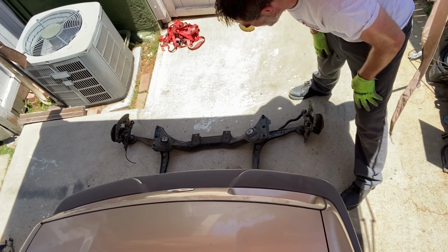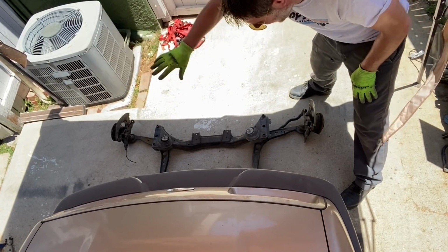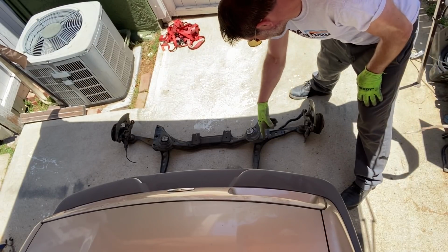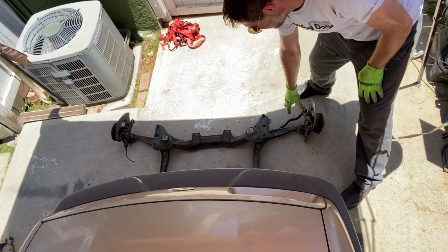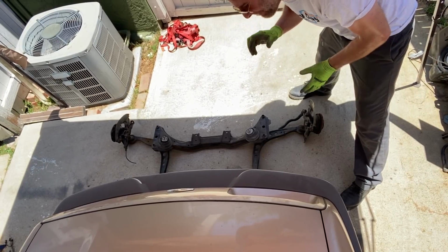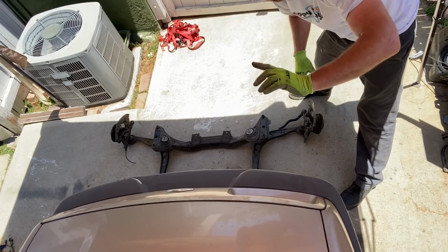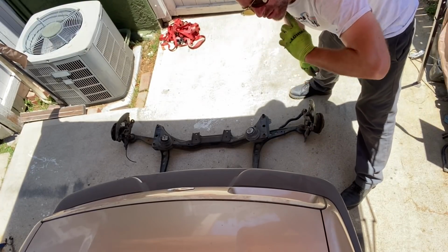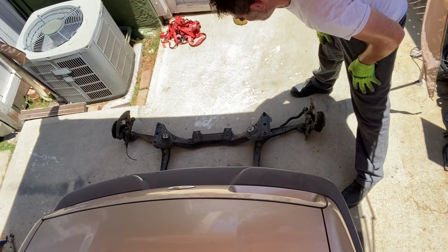So what I plan on doing is creating mounts on the chassis rail for the rear mounts of the arms, doing coilovers on the front end, E36 coilovers on the front end, and modifying the top mount so they will fit straight into the stock Merkur XR4Ti / Ford Sierra top mounts in the chassis.